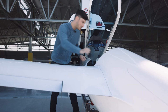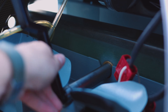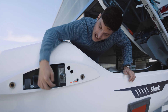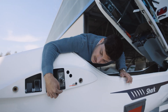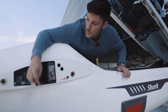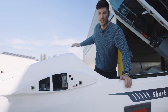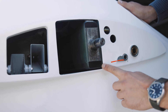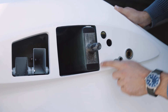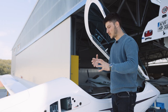We use the main bolt here to secure the wing on this side. On the lower side, you should have a gap of about two millimeters. If there's no gap, you can lift the fuselage or lower the outer wing. Once it's perfect, if you wobble the fuselage a little bit it moves here too — you need this little bit of play so that the other wing slides in easily with the bushing.